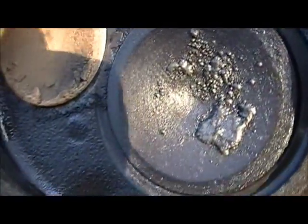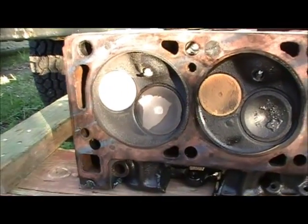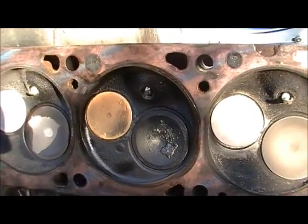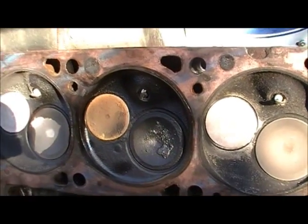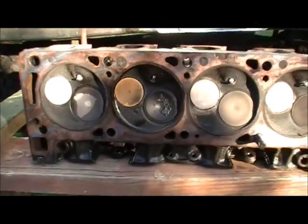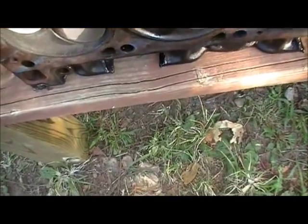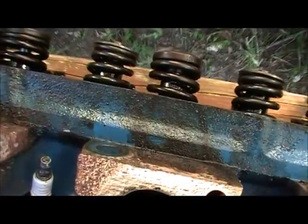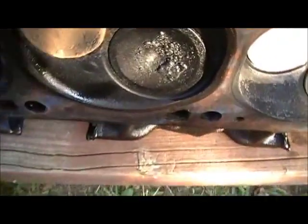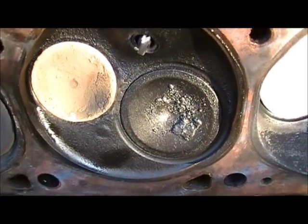I knew it was getting where it wasn't running quite right. It had a bad idle for a long time, and then it just got to where it was getting hard to start. It would shake real hard — just had a bad torsional to it. I checked the spark plug and this plug was bad. I went ahead and tuned it up and all that other stuff you saw me put on previously. That was all bad, which probably helped.